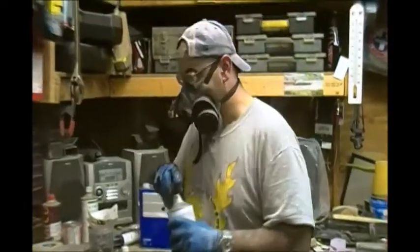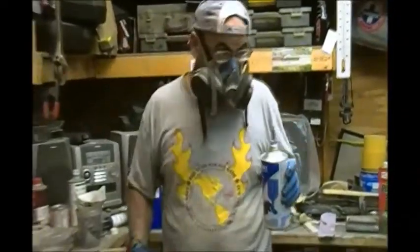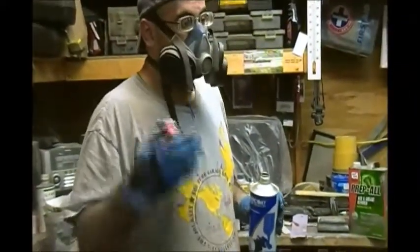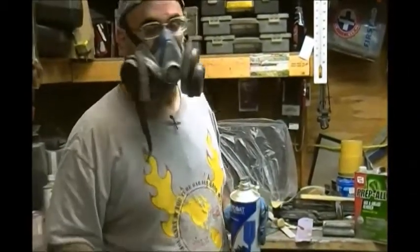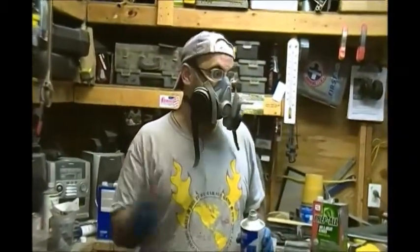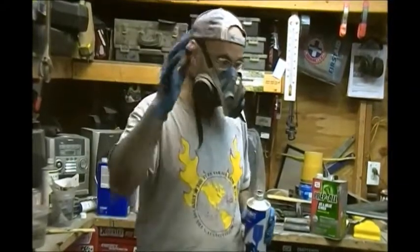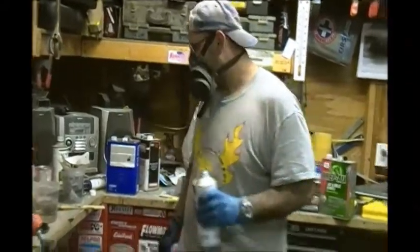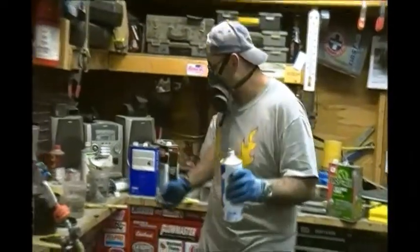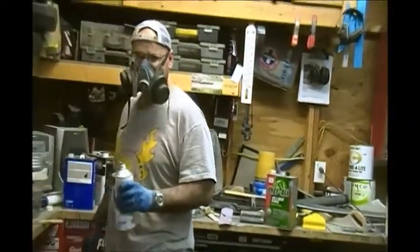Hey guys, I'm essentially going to use a hot clear for an intercoat. I'm going to put two coats on the black and seal it for tonight. Tomorrow should be good enough. We're going to lightly scuff it and then start laying out the flame pattern, which is going to be fun. Then I'm going to spray the silver base, mix up some candy, spray it on top, and then just slam clear on it as much as I can, build that up, get those proud edges buried. So right now this is essentially an intercoat clear. It's actually a regular clear, but I'm using it as an intercoat, so we're going to go with that. And that's my story, and I'm sticking to it.